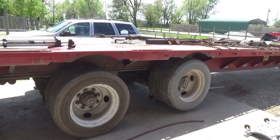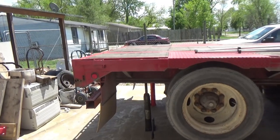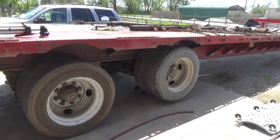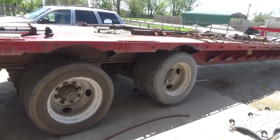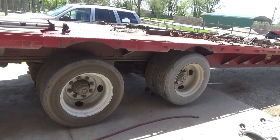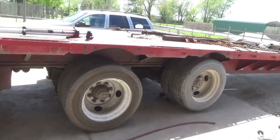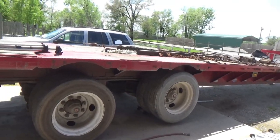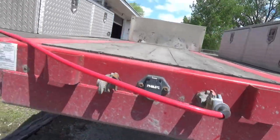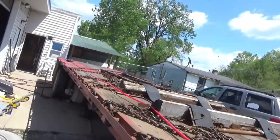Let's get started. I'm going to pull those wheels off. I've got it up on two hydraulic jacks in the back, raised up off the ground a little bit, on the front legs up in the front, and just a regular floor jack underneath the axle on this side. I've got an air hose on the trailer hooked up to the shop air, and that releases the brakes for me.